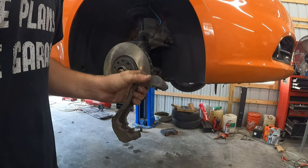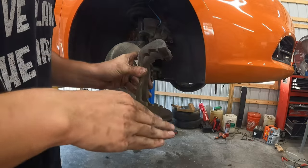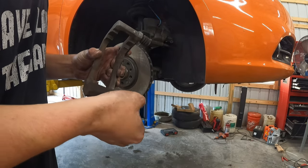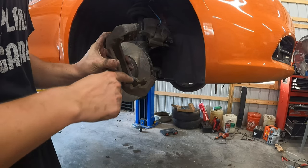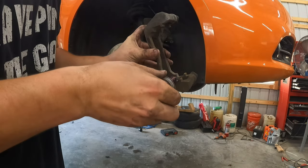All right, so it's dealer's choice next. I'm going to put grease underneath the hardware, put the hardware in, and then slide it in, and then I'll do my slide pins. None of them are seized, but I'll do my slide pins. If they were seized, I'd do them outside of here, but wait until it's bolted on. It's your choice whether you want to put grease under here. I'm going to, because it's habitual, but you will see people all over say different things about it.